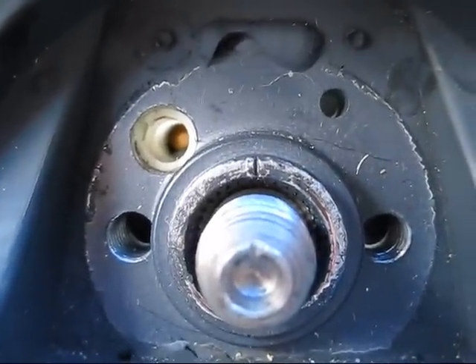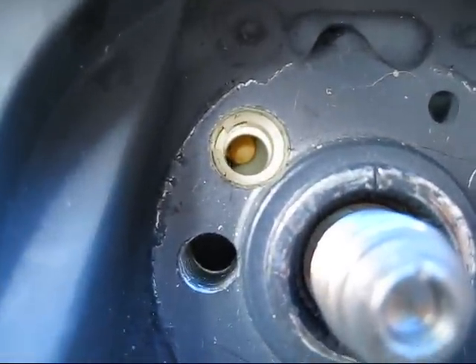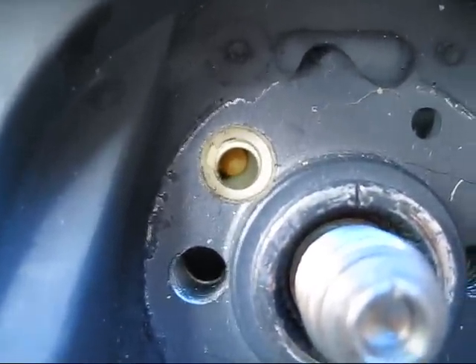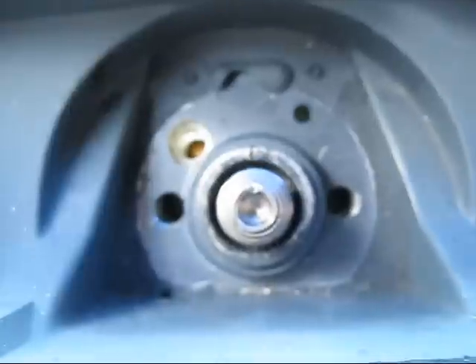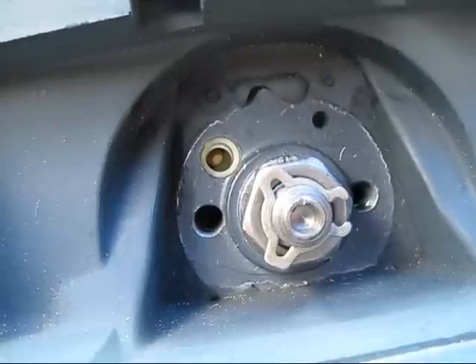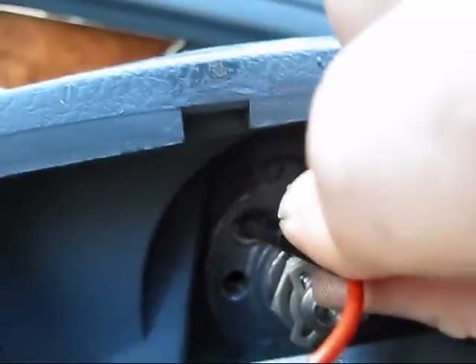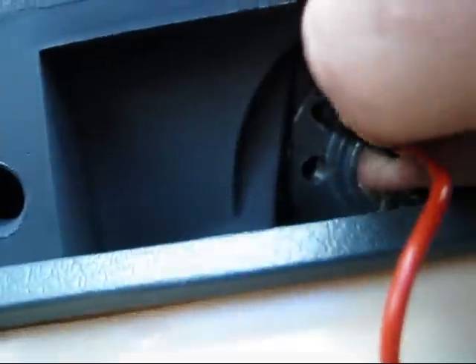There's a little notch at the top of the steering wheel and a little notch at the top of the shaft, and you want those to line up. You also want the horn contact to match up. So once you get that done, push down on the wheel like I've done here, and then you can reinstall the nut. Screw the nut back on, tighten it up. Reinstall the retainer clip. Last step is reinstalling the horn button. There's a plastic black tube here with a little notch in it. It holds the wire in, and you just push it in and turn it clockwise, and that holds it in place so your horn works. And then you just push down on it.